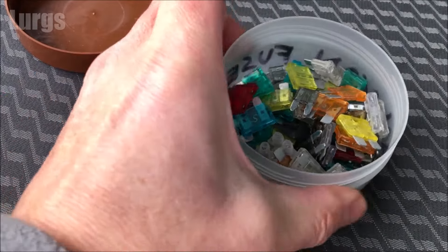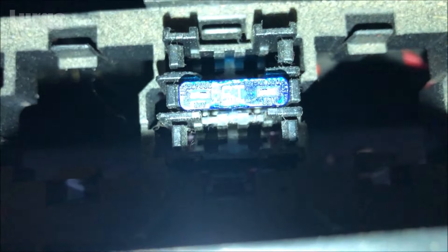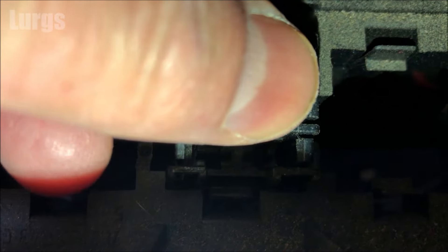While I'm taking out a new fuse, there's a link above about how to replace the pollen filter on this van — ideally do that once a year. Take your new 15 amp fuse, make sure you put it in the right connection. On mine it was the middle one, so just line it up and then push it down home with your thumb.